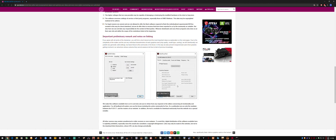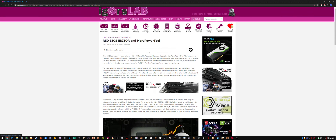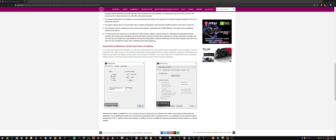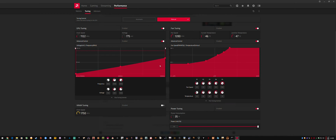There are a few other things you can do — read through the guide for more detail. For example, you can disable zero RPM if you don't want the fan turning off completely and prefer a minimum fan speed. There's a driver-level option in More Power Tool to turn off zero RPM if your GPU supports it. You can also disable fan acoustic RPM limiting, which tries to keep the fan speed down based on noise — I had mine turned off. Otherwise leave everything default; the main goal is just unlocking the headroom.